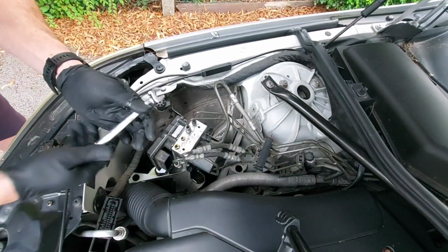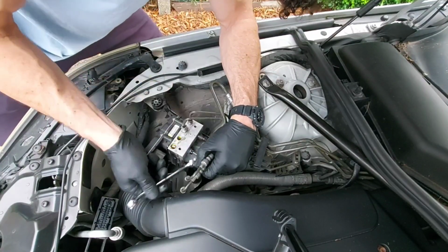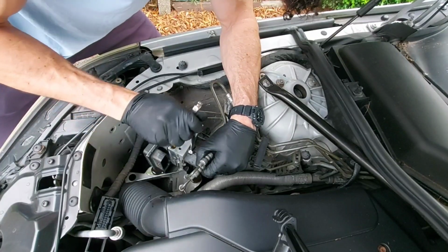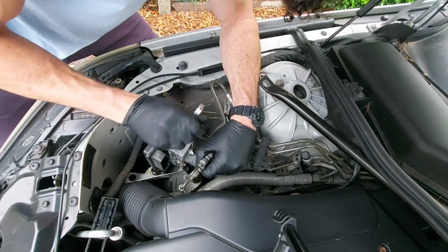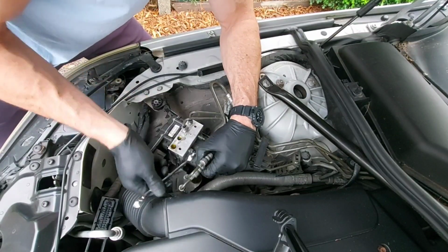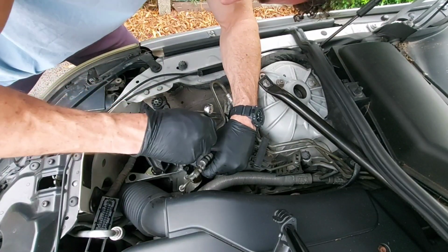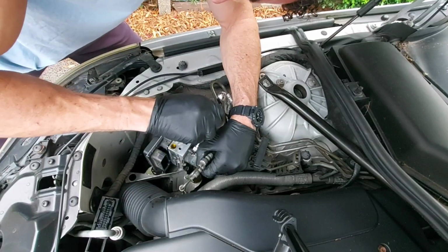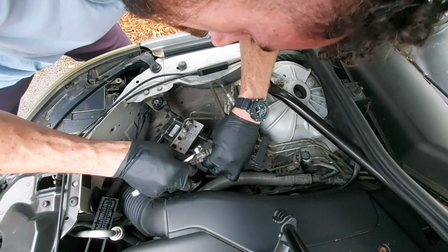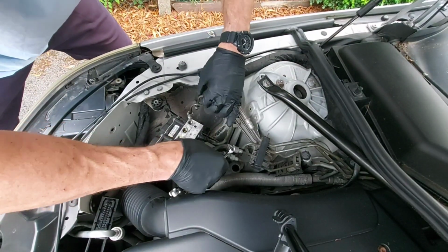And this is where all the brake fluid starts leaking out. But there is not much we can do. Just got to be quick. Oh, that reminds me, I was meant to clean the other one before fitting it. I need to put some brake cleaner in these because there's some dirty old gloopy bits of brake fluid in there, it seems. I've just got it out of the box, and it's a second-hand one, so it's not the cleanest. But we should have some time now these are out.